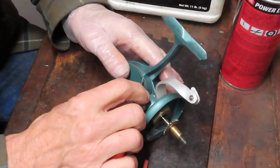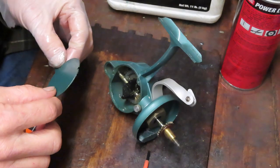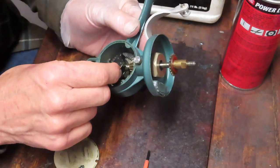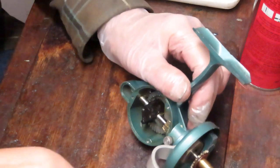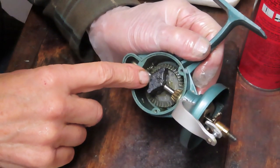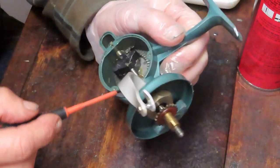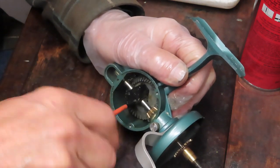I'm just going to try and get the case off. This has got good paint so I don't want to go banging things around too much. The back of it's a little dirty, and it looks like we have a crosswind block similar to a lot of ones we see out there — it's probably riding on a stud. I went and grabbed a cotton swab. There's a separation, but what I thought were snap-on studs appear to be small screws. This is a good point: you want to be patient. You don't want to force anything. It'd be very easy to jam a screwdriver or wedge in there assuming these things are studs when in fact they're screws, and you'd wind up breaking the block.